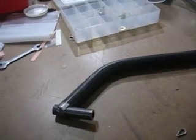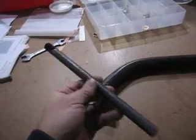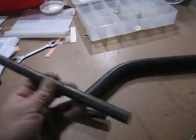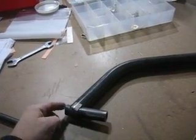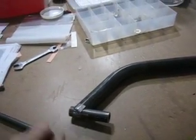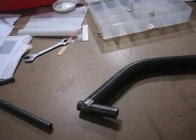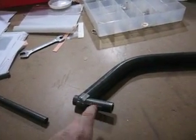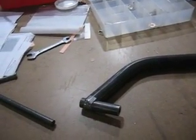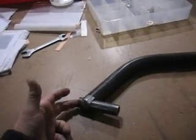If you run the O'Brien brakes that we sell today, we use the solid axle, and we actually weld a flange here to accept the O'Brien captive disc — five-eighths diameter axles. But you guys with the Matco brakes would receive it in this form, because your Matco axle will have the flange for the brake mounts welded to the Matco axle. It just plugs in here, five-eighths.